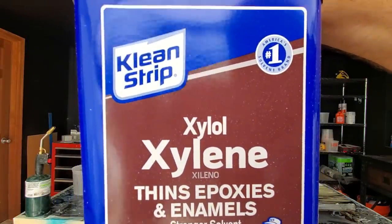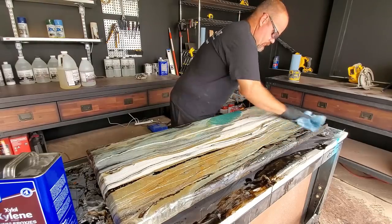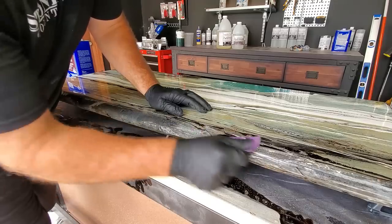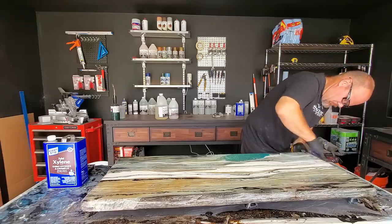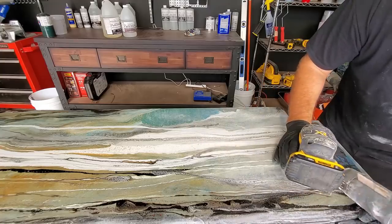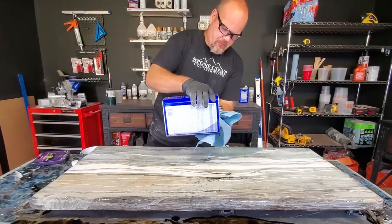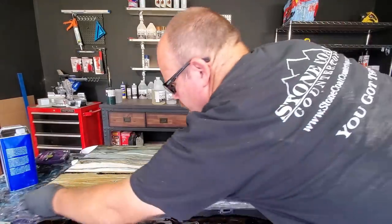Time to wipe that color coat with xylene because it's already dry and ready for the next step after a few hours. I'm going to use xylene to wipe away any of that surface spray paint, to open this up and get the platinum ready for the clear coat. Then I'm going to sand with a heavy 80 grit — I want a strong mechanical bond and good adhesion between each layer. After wiping with xylene, I'll sand with 80 grit on the edges, then work my way to the top with a random orbital sander to be sure I sand everything. Then once again I'll use xylene to wipe away any sanding dust and prep for the clear coat.